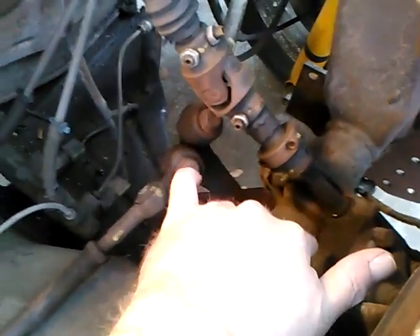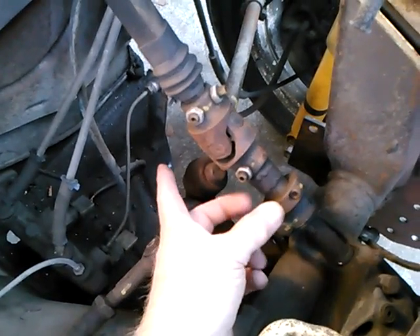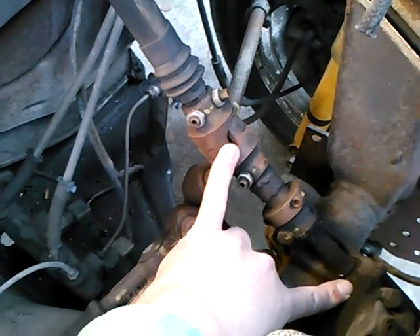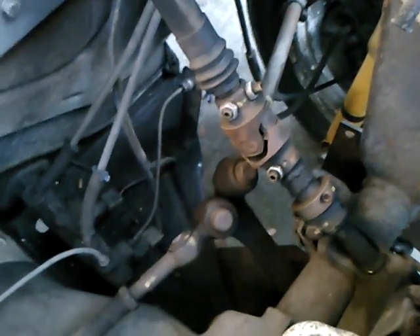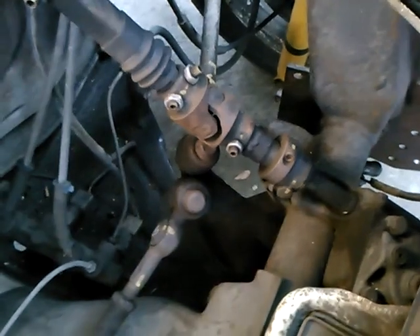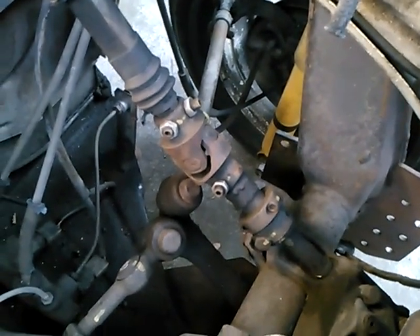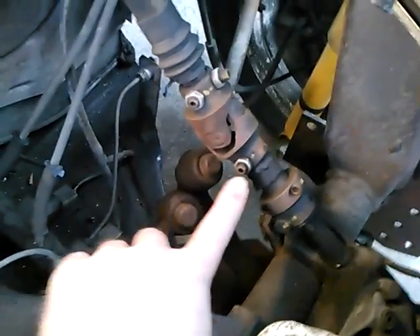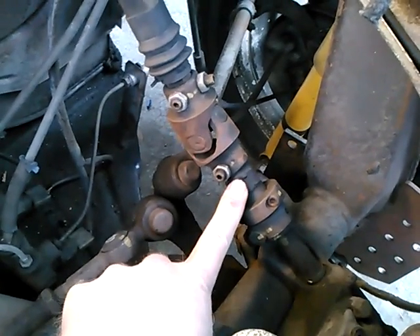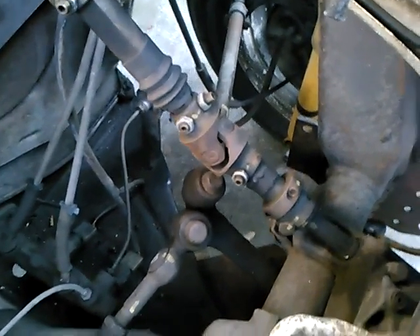But what still keeps me up at night — because of the three-inch offset — we're not only putting a torsion on the shaft as we steer the car, we're also bending it back and forth now. And this lever arm, which I made as short as possible, does not exist in the stock arrangement. If you look at any OEM steering system with U-joints, they always make this distance very short, often mounting the U-joint right at the steering box. So I've considered — though not yet executed — putting a support bearing here. But that would add its own complication in that the alignment between it and the steering box would have to be dead nuts, otherwise the bearing would be introducing its own bending of the shaft, which is what we're seeking to avoid.